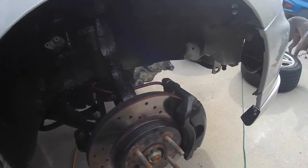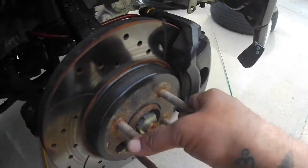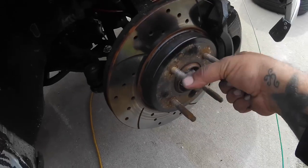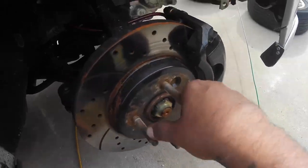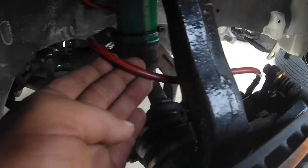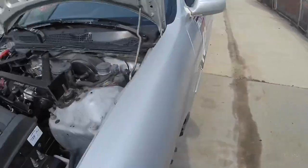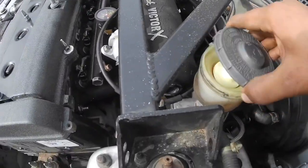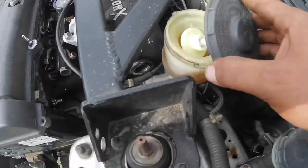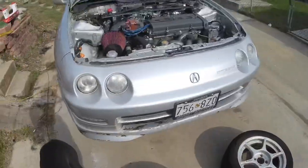Next up, they want you to check the brakes — at least 50% pad life, which I'll definitely have. No excessive cracks or warpage on the rotors, which are good. The brake lines are clearing the caliper and the wheel, and fresh brake fluid, which is pretty good too. So that passes. I'll just go through and inspect the rest of the wheels to make sure everything's good.